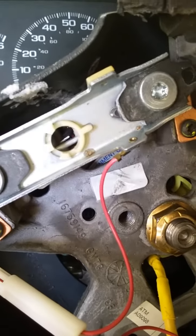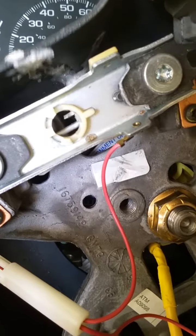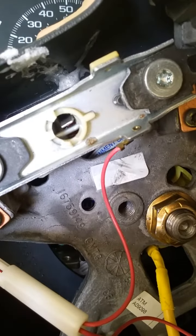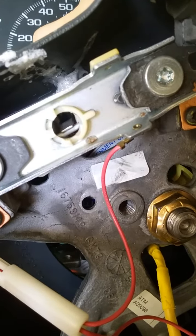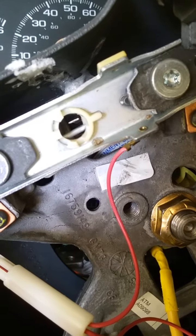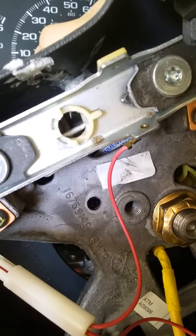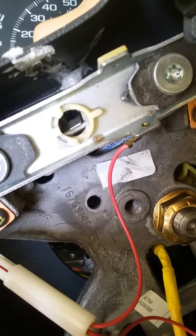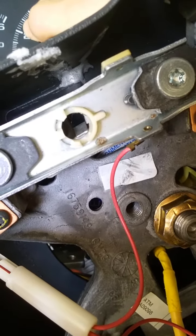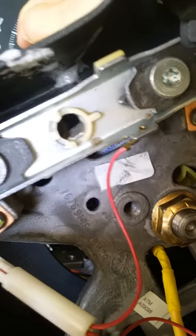This is why I made the video — just to give you guys a heads up on what you're going to be looking for. In order to accomplish removing that airbag, you've got to bring the screwdriver in through the back. Mind you, that pin is right here and it's a sturdy-ass pin. You've got to get it perfectly in there and depress the spring in order for it to pop out.